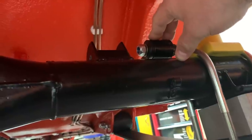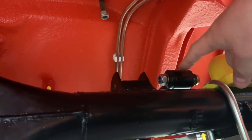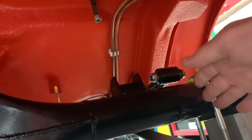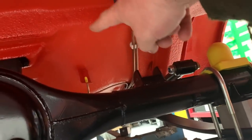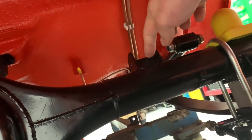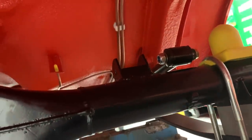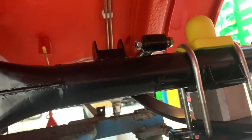The later method was where you had little turrets in the boot floor for the shock absorbers to go straight up into. What that meant was the anti-tramp bars had a dog-leg, which came across into the bracket to miss the shock absorber. Unfortunately, the brackets on this axle are for the later style with the dog-leg anti-tramp bars, but we've got the straight ones. So I've got to move the bracket over to suit this application.